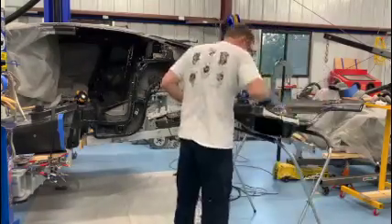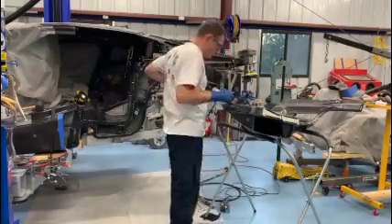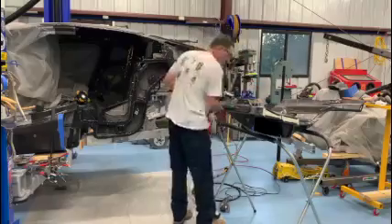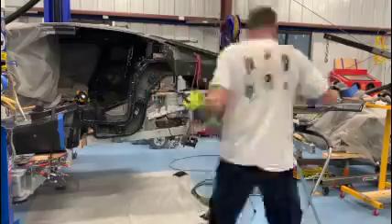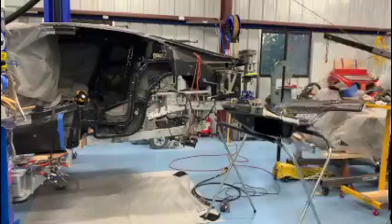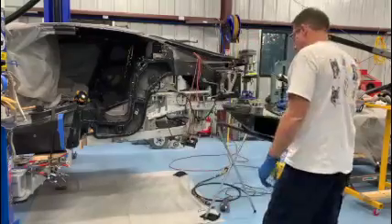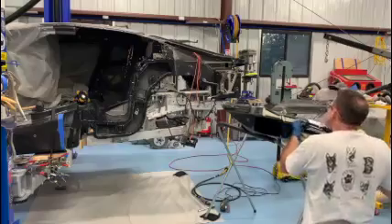That lower carbon fiber frame area where I have those carbon fiber plates on the inside — they actually mate up with the area just to my right there, you can see the end of that quarter panel lower frame area. That carbon fiber lower frame area is filled with a foam very similar to house insulation — it's dense, provides no strength, I think it's there for sound deadening. You can see I've got some slots relieved out of there, and that's what I'm filling right now — that's where those receiving plates go to bond the inside of that carbon fiber frame area together.